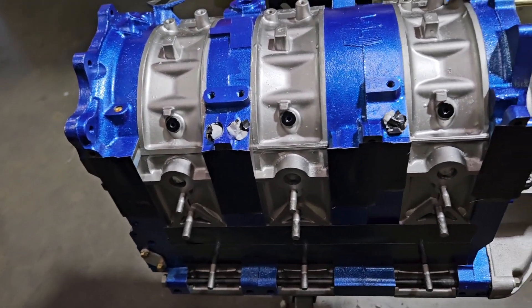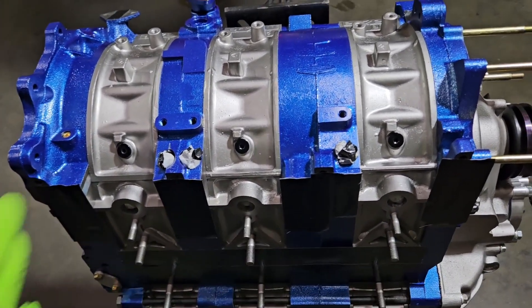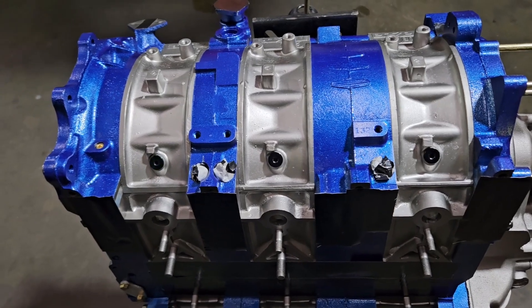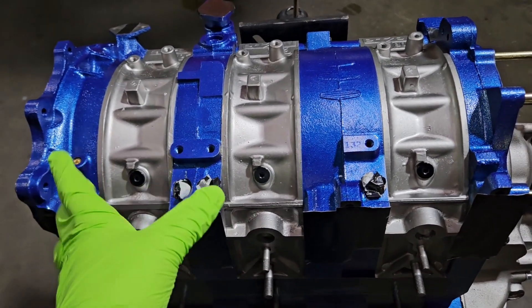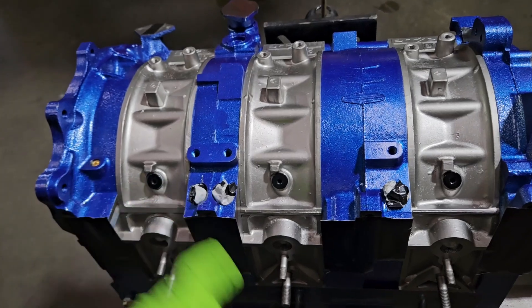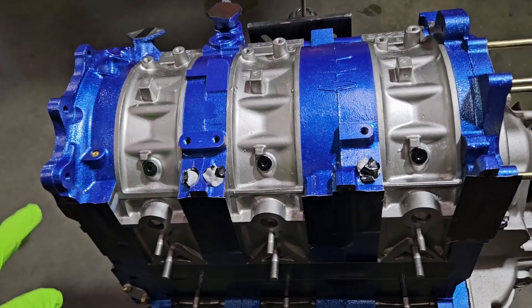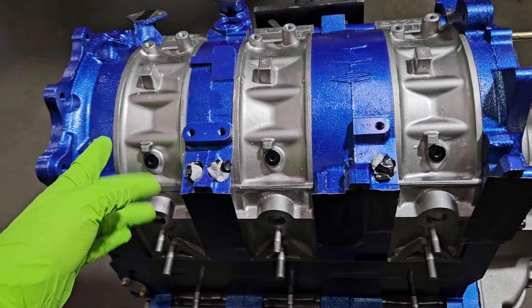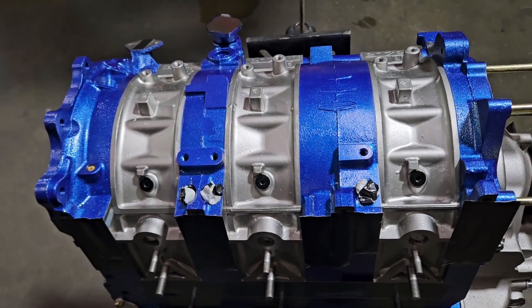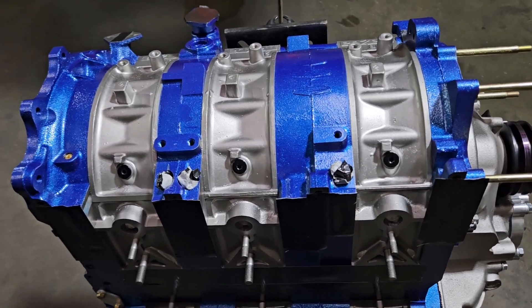Moving on from the bearings, we polished the eccentric shaft — it got a micro polish. The rotors themselves are the factory 20B rotors, so they're a very close rotor split. Everything's within about four grams, and then it went out for high-speed balancing at Mazda Tricks. We also did side cutting and narrowing of the rotors so they have more clearance for high RPM and high boost as the shaft and rotor moves around. The side cutting, polishing of the shaft, and high-speed balancing means that under high RPM and high boost, you're not worried about the tip of the rotor coming in contact with the side plate. This can cause pinching of the corner seal, pinching of the side seal, and it can look like an over-rev or excessive wear, cutting the lifespan and compression life of the motor down.